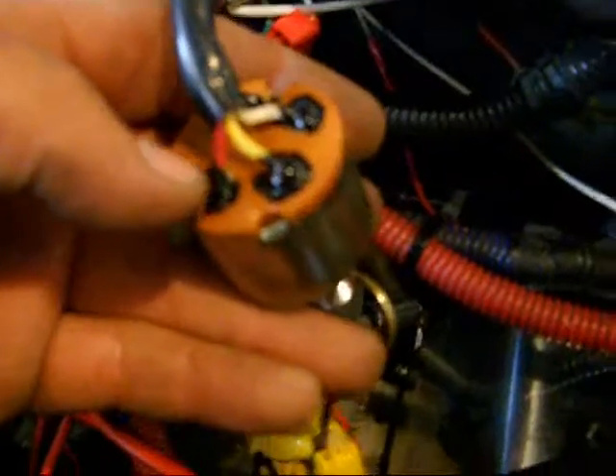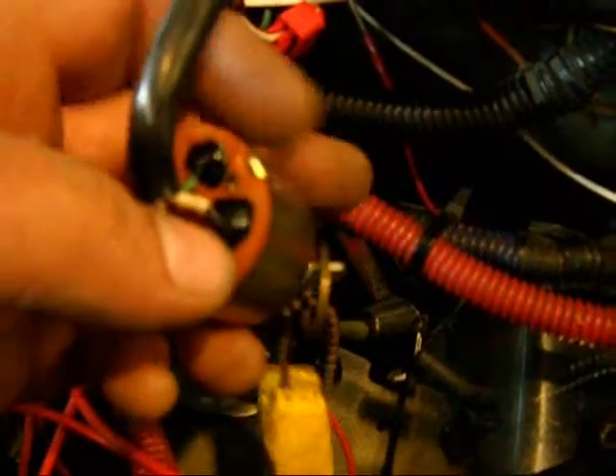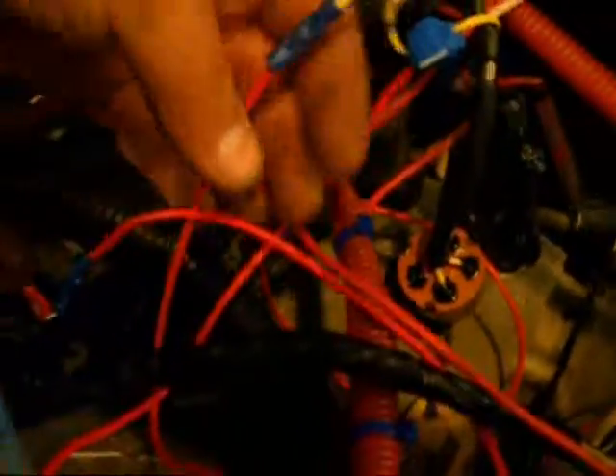This green wire — temporarily I just pulled my switch out of my dash. The red is always hot. The yellow is key-on accessory power. The white is key-on. The green is start position — sorry about that correction. So that green wire coming off the ignition switch, I had to run a wire down to my starter for crank mode. This is the old one — I'll just put a dead-end terminal on the end of that. I ran the fuel pump wires through there, brought them around and up through there.